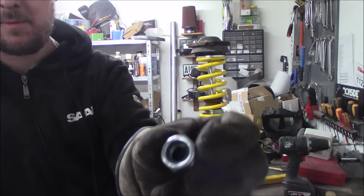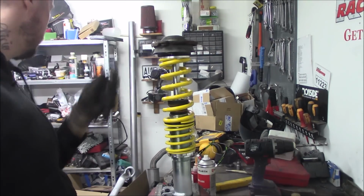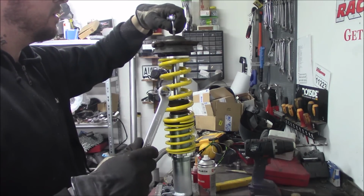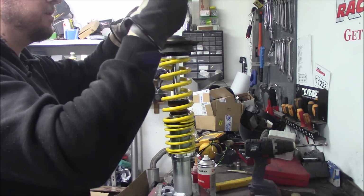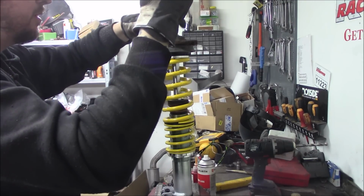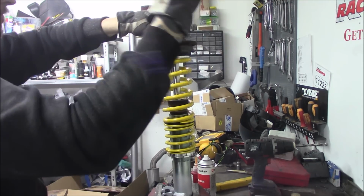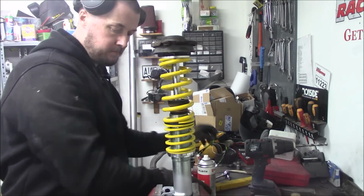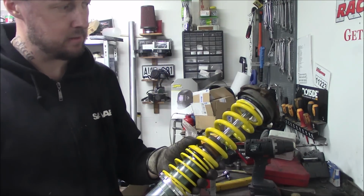And then the top nut, which has locking in it. So the rod has a 6mm hex fitting to it, so you can hold it still while tightening it, because this one you don't want to use a vice grip or anything like that. Like so. So it's fully assembled.